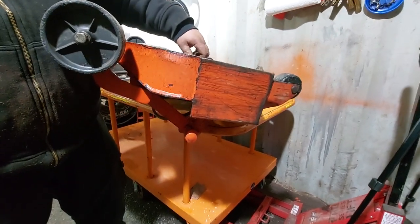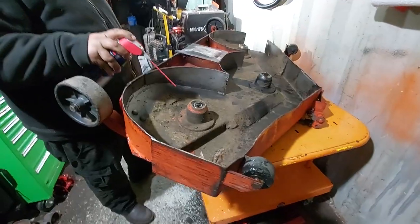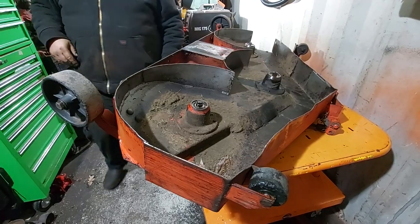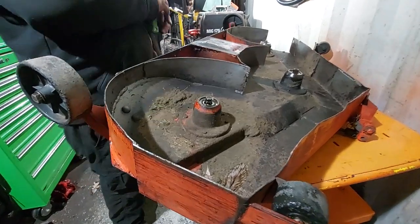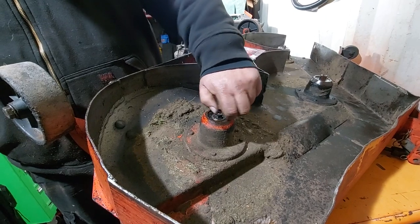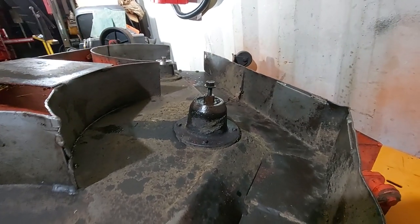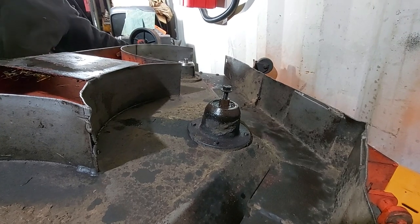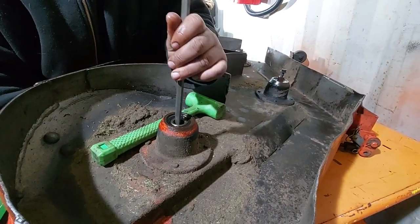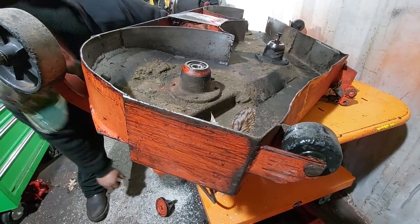Like we said, these all come out one piece from the top. Make sure you've got clearance underneath. What I usually do is thread the bolt in a little bit and spray some penetrating oil. Then re-thread the bolt in so you don't damage the spindle threads if you're going to reuse them — they should drop pretty easy. Then do the same thing, make sure you've got clearance underneath, and they'll go the rest of the way with just a push.